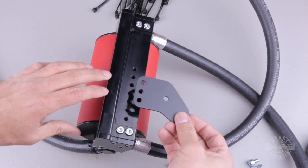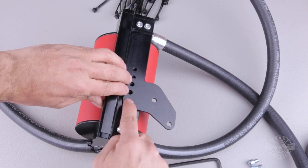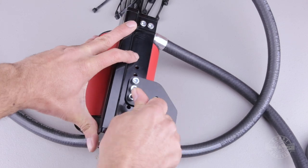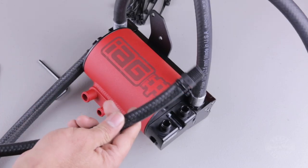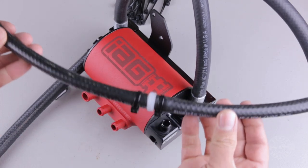Install the bracket with the bottom screw on the third hole from the bottom. Start all the screws by hand and then fully tighten them with an Allen wrench. While we're here, install the included PCV hose — it's the only one with a PCV valve right in the middle. It should come pre-assembled, so thread it by hand first, then once you feel resistance grab an 11/16 wrench to finish it off. It's a plastic fitting so don't over-torque it.